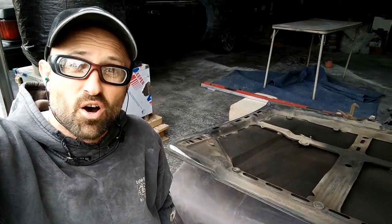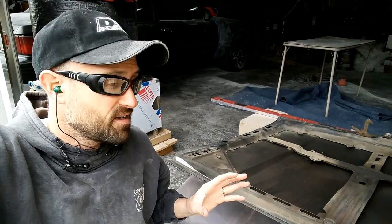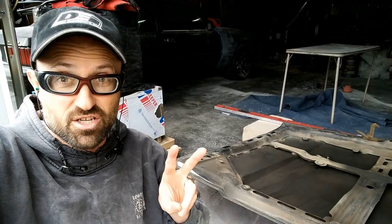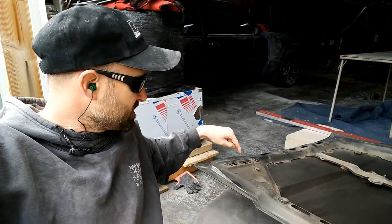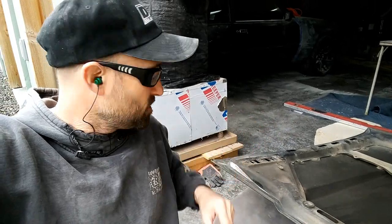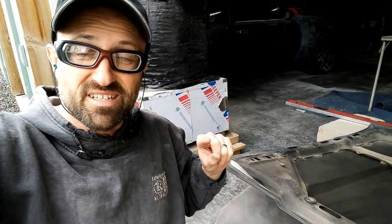All right, so now that you know where the starting point is, what we're going to do is show you how everything is mounted. The hood itself has 2 rear mounts, which are the hinges. The hinges have a bolt that goes through the hinge into basically a captured nut. The nut itself is going to fit onto this, so you can see these are slotted widthwise, cross-car. Not so much movement front to back. The front to back is actually built into the hinge itself.